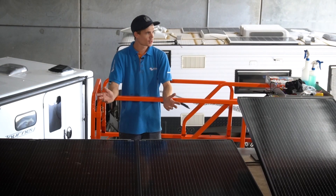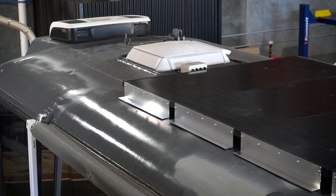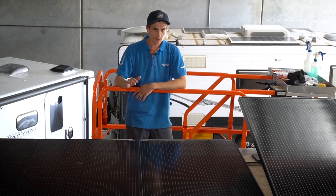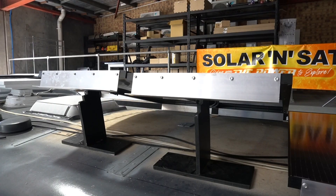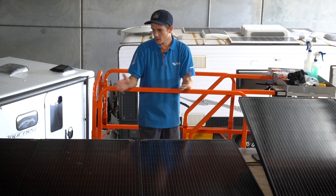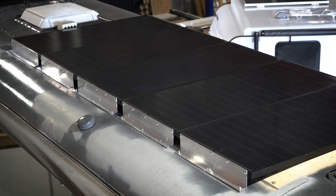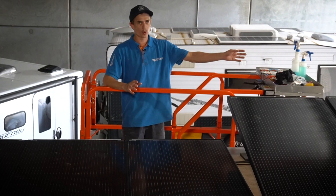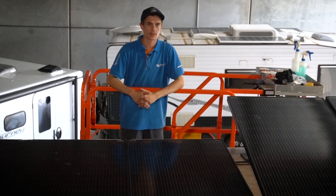Back on the roof of this big coach — previously I've done a SatKing Promax satellite install. As you can see, the roof has got a big curve in it. We're not able to use our standard aluminium brackets because the solar panels wouldn't sit correctly. So we've cut down some 100 by 50 aluminium angle, mounted that on the side so it props up off the roof and sits properly. I've installed five 200-watt panels at the front and another four 200-watt panels at the rear, giving us a total of 1,800 watts of solar on the roof.